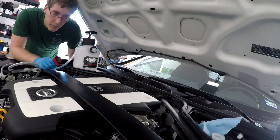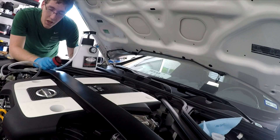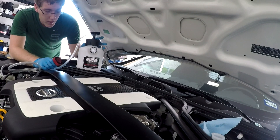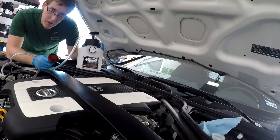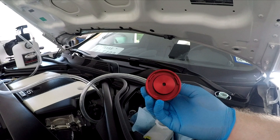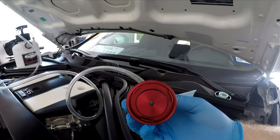A lot of people make the mistake of just reinstalling the filter and calling that a job. But in order to change the brake fluid, you need to actually flush the brakes — so the job's not finished yet. To do that, you need to use this automotive brake bleeder. I'll leave a link in the description below showing you where you can pick this up. We need to go ahead and attach this to the brake fluid reservoir so that we can flush the brakes out properly. It's important to make sure that this side of the bleeder is free of debris — you don't want any dirt getting inside the system, so make sure that's clean before you install it.